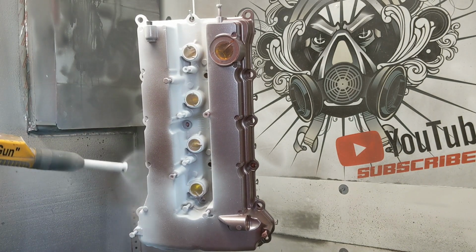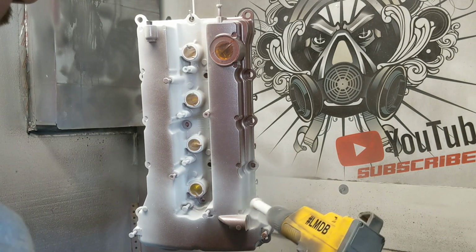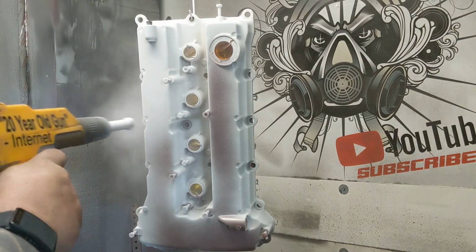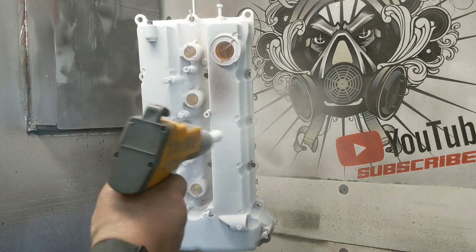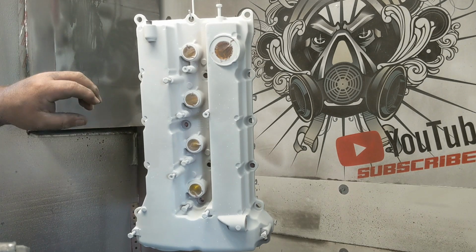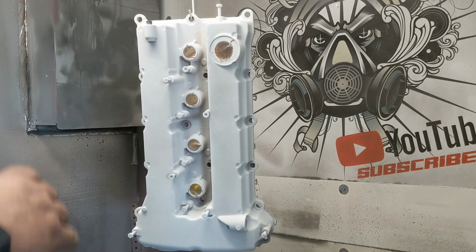And one thing you want to make sure of when you're doing the top coat, especially over an Illusion or a dormant candy of any kind, is that you get enough clear on it, or whatever your top coat is. Traditionally it's a clear of some kind, because if you don't, you'll have spots that don't flop over into the candy finish that you're ultimately trying to get. If you ever do a job like this, you'll see spots that are still kind of silverish looking or not quite the same color, and that's an area typically that you didn't get enough clear in. There are some other factors that I've seen play a role in that, but they're pretty rare.